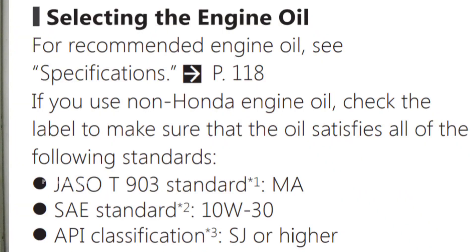What do you use in this brand? For all these models, you will refer to the user manuals and prefer to use a new oil. You will refer to 10W30 as the recommended oil. If you have any doubt, you can download the user manuals for your Honda Bikes and check the standard model — it is JASO MA2.